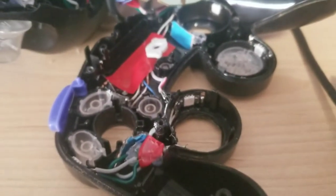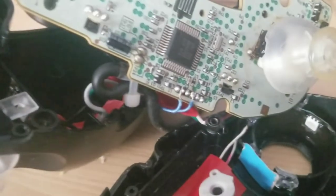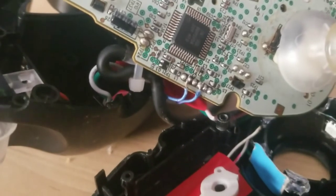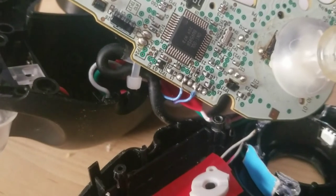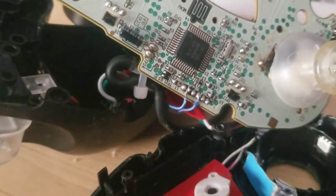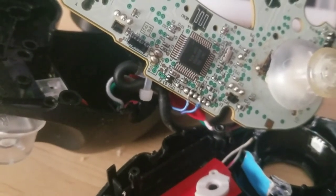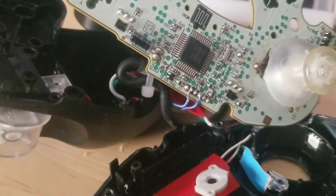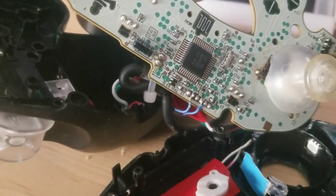Since it's just power, all you have to do is tap into the power of the GameCube controller. The wiring is poorly color-coded as I have two of the exact same colors, but one is ground and one is 5 volts. You're tapping into the 5 volts of the rumble, so this works with original GameCube controllers. Other controllers such as the WaveBird would not work since they run off 3 volts.